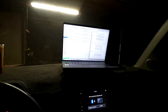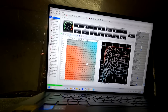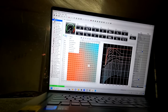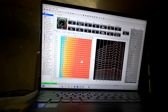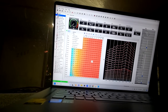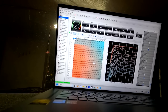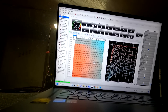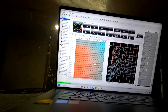Class is in session. Every time, like, so 15 degrees. This is literally what you mean by tuning VTC. Yeah, so every single time you change VTC, it will have its own fuel map and its own ignition map. And since this is 30 degrees, factory. Yeah, factory. So 40 degrees and 50 degrees is the exact same map as the 30 degrees because it doesn't go beyond that.